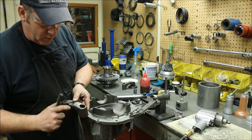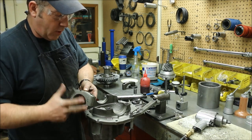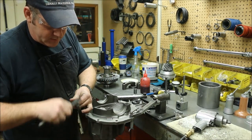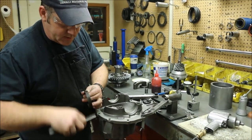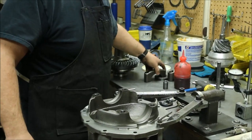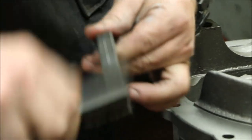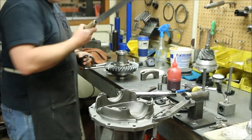Make sure there's nothing packed into the holes. This is a threaded hole. If you don't have this lock on here, you can actually ruin the whole part because it does have to lock the spanner. The spanners themselves — it's a thread, and everyone knows if there's a damaged thread it doesn't want to move. This is pretty essential because this is how you set your preload for your carrier and it is also how you set the backlash on the assembly. So you want these fairly free. These look really good.